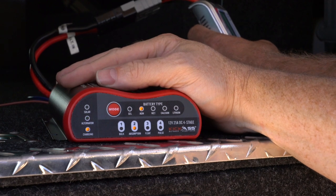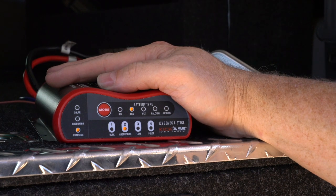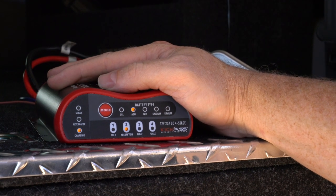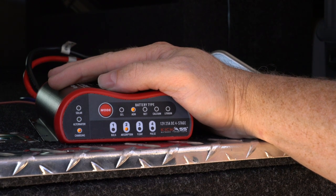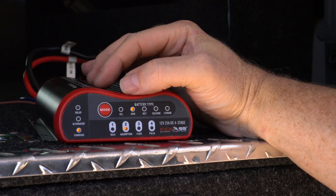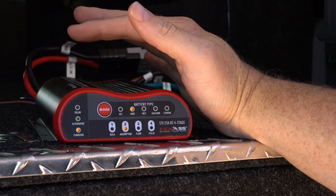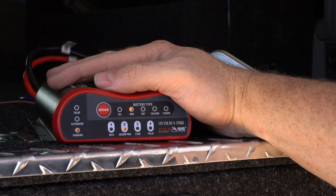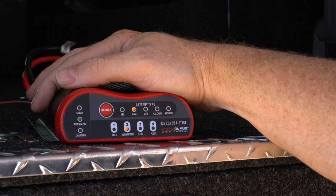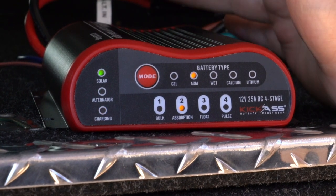When the vehicle is switched off, there will be a 120-second delay before the unit stops charging. We've included this 120-second delay for when the vehicle is off or when the vehicle's voltage falls below 12.8 volts, because smart alternators or temperature-compensating alternators may drop voltage. This delay gives a buffer until the alternator charges again, and it's a great feature to keep the consistency of the charger charging.